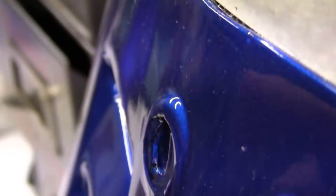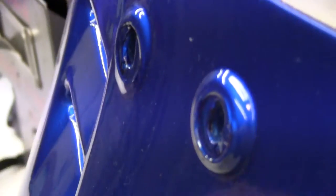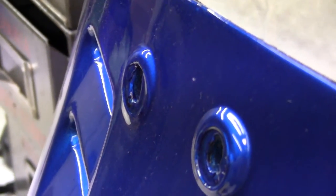Let's see if we can get some HD up close here. You can see where the orange peel is right there — it's all over this, which is no problem. What I would do with this is take about 1,500 or 2,000 grit. 2,000 would take a while but I could do it. You can see the orange peel right there.